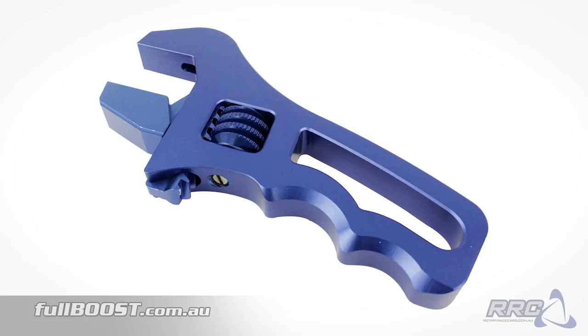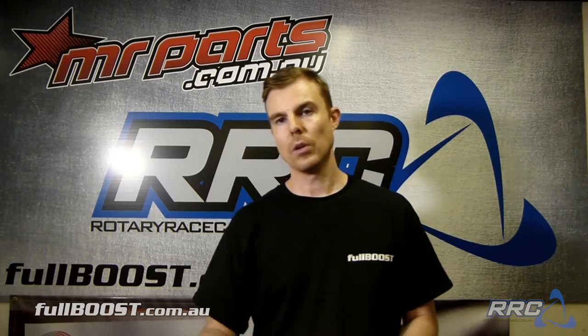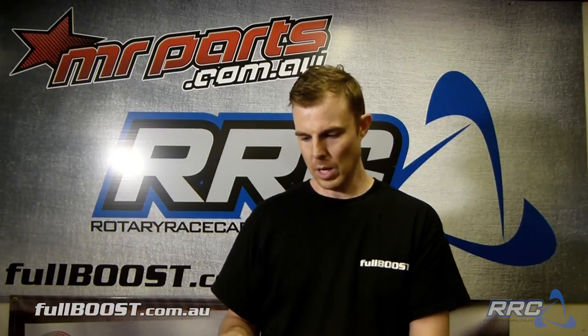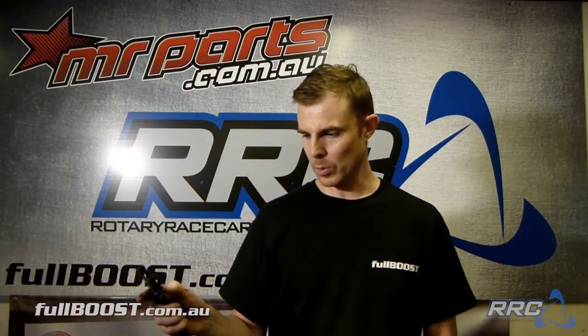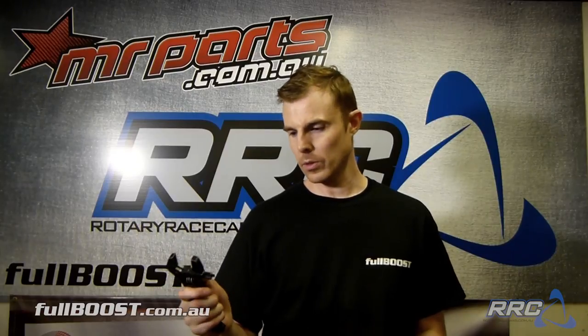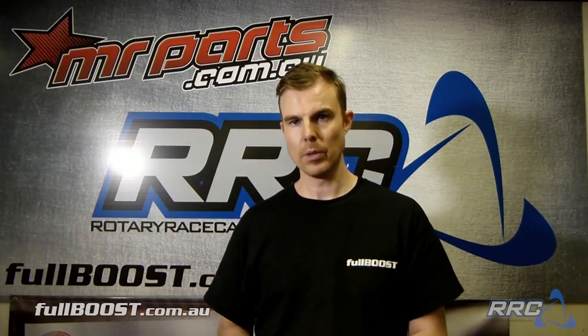So they're really nice, they contour to your hand. You can also get a short one. So they're very good if you've got to do tight space stuff like the turbo oil drain is often one that's very hard to get to. So there is a stubby wrench that you can get. This only will do up to about size 12. So just remember that if you are doing any hoses larger than size 12 that you pretty much have to use these.